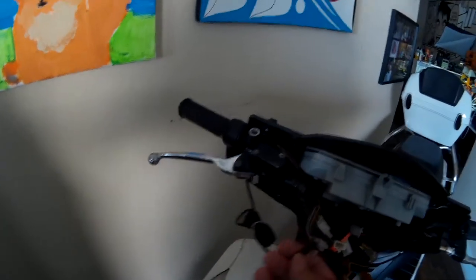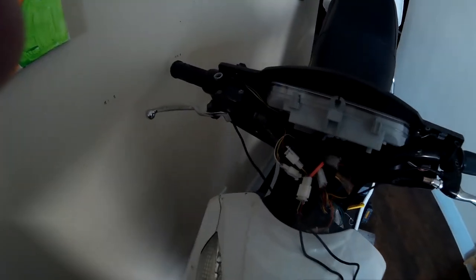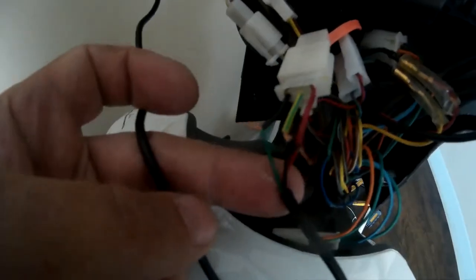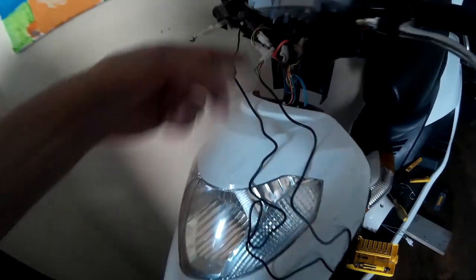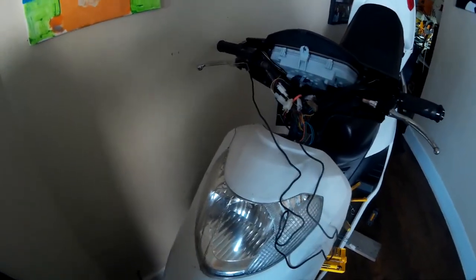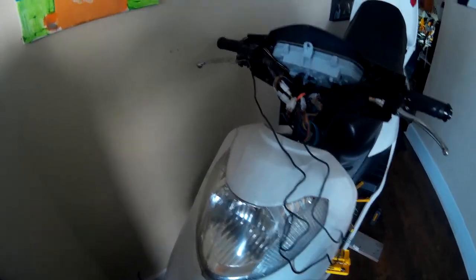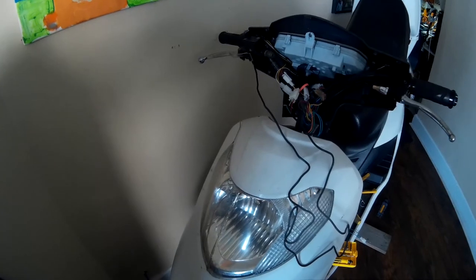Right now we have to figure out how to get this onto this. We're going to have to either cut this and put an adapter on it and give it a test. Well, I did test it — it's working pretty good. I've got a semi-permanent connector there. I'm going to leave the wire long and just tuck it in and tie it up. One thing I did notice with this throttle — there are different types on the market. Some will actually slow the bike down, others will speed it up. I'll leave a link in the description for this brand because this one actually speeds the bike up. Got a few more RPMs out of it.